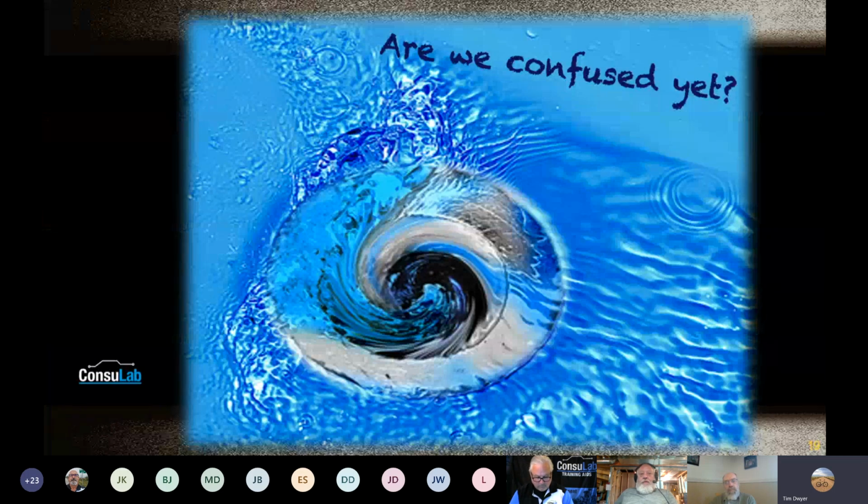And the part I didn't like about this model is that it really didn't address the ground circuit. It didn't address how does the water get back to the water tower once you let it out of the hose. It goes into the gutter, runs down the street, disappears, magically shows back up in the battery. And as a result of that, I think we've read 90% of technicians can't perform a voltage drop test. And I think I saw someone from ASE log on to the chat today, and I've heard that their tests show that a simple voltage drop is not really done properly by a majority of people out in the field, let alone people learning. So I think our mission is to take some of the confusion out of this.